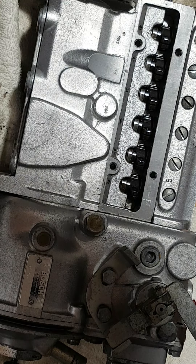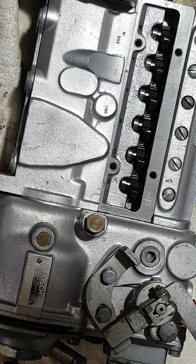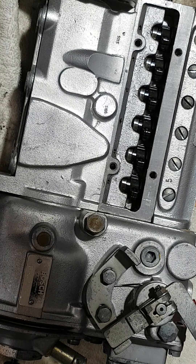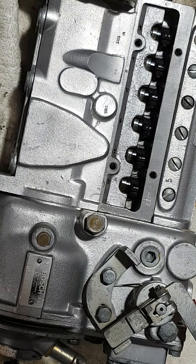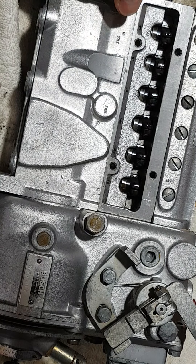By inserting this 5mm screw with a 0.5mm thread pitch, you can screw it into the rack, then just pull it — and the rack comes back on its own very quickly and precisely. You push it that way and it does exactly the same thing. Very smooth.